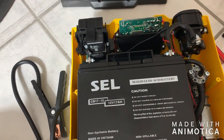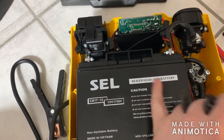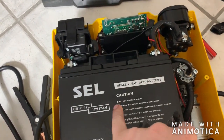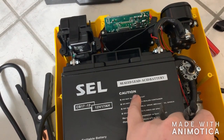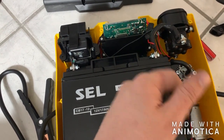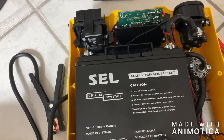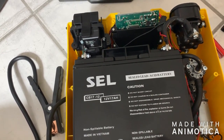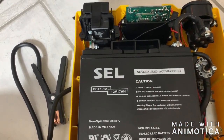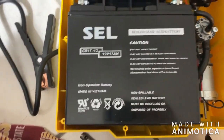You want to keep it always charged, but it probably has some self-drain. The other thing is if you leave it plugged in, you're basically just heating the battery because it has no way to store the extra electricity. You're putting all 10 watts into the battery, which causes the electrolyte to heat up and evaporate quicker over time. So ideally you keep it fully charged but not plugged in all the time.